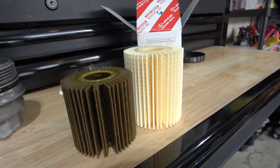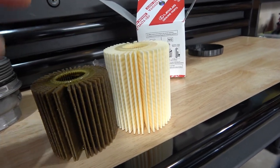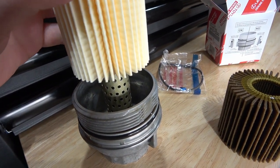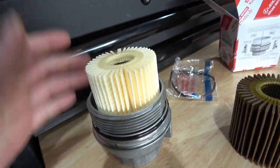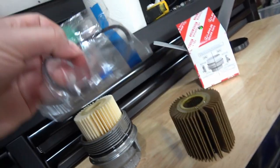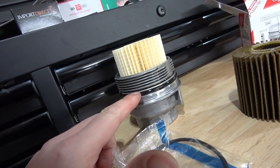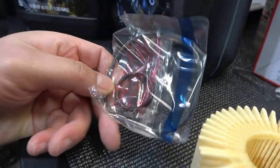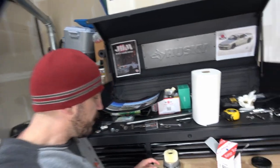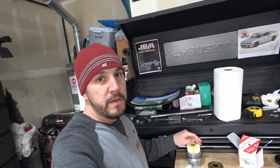Here's the A1 that I pulled out — that was recommended by Walmart. This is the A3, and you can see it's about a half inch longer. Let's go ahead and stick it down in the filter assembly housing. It's supposed to be a little long like that. This only comes with the new rubber gasket seal; the old one came with a drain plug as well, which is not necessary for the IS 250. There's also an A5 which is the same length as the A3, but the A5 comes with a little plastic drain plug and an extra O-ring that we don't need for the IS 250.